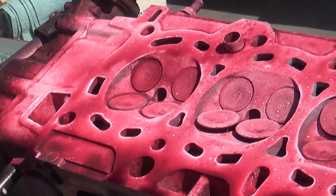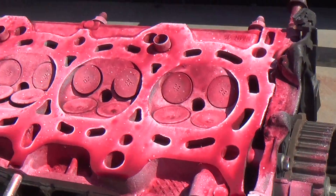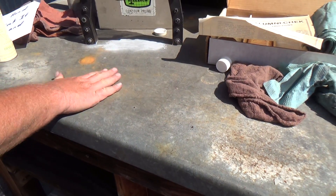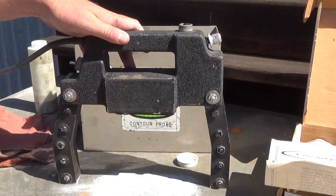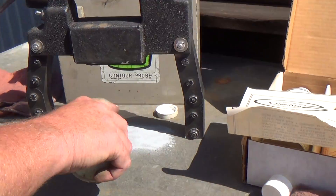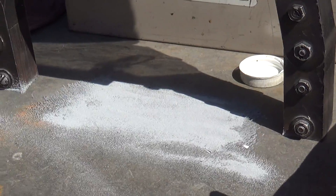We have to wait 30 to 60 seconds to see if there are cracks. While that's waiting — this is what you use for aluminum heads. If it was a metal head, like a steel head, you would use a Magna-Flux system. You put a little of this Magna-Flux powder on, then use this super magnet — you turn it on and hit the button.